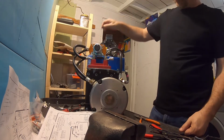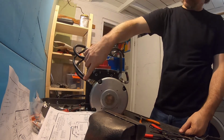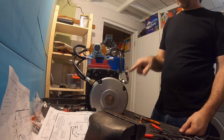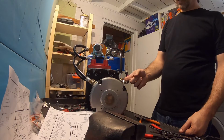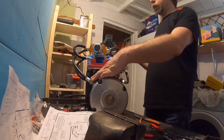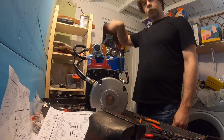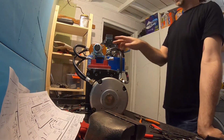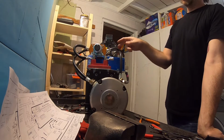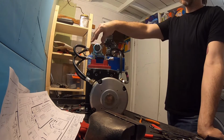The switch has 4 terminals, and we got one going to an armature winding. We've got one of them going to S2 and the other one going to S1, and that is indeed how you sort of switch the wiring. You got another one down here at the bottom, the last one, and it is connected to our contactor.